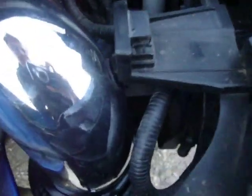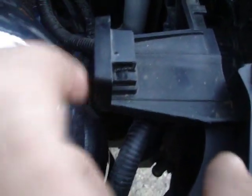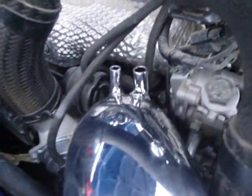So once you've got your filter in, you'll notice that it's not all that low, really, to be honest. You'd have to drive through one monster puddle in order to suck water into your intake. But either way, once you've got everything set up, you'll notice the rubber pad is there, and it's right where you need it to be to protect your intake as it bounces around in your hood. You just go along and tighten everything up. I'll show you guys where I put everything. Right between there is how I got that to line up to screw those in tight. You tighten them up with about 15 or 16 foot-pounds of torque.